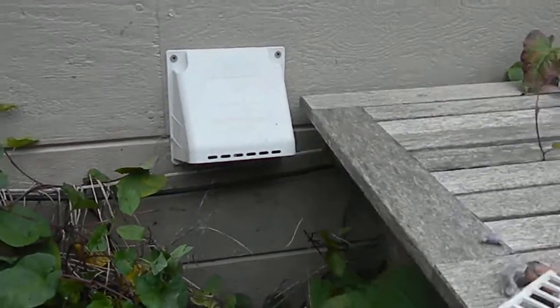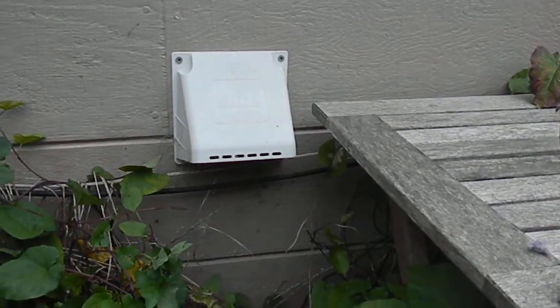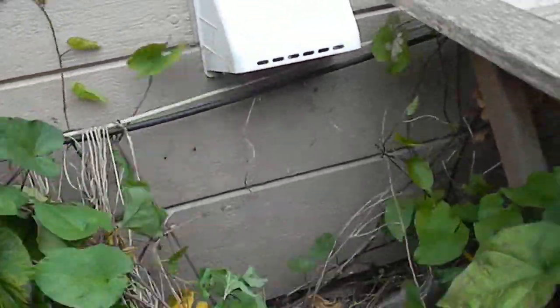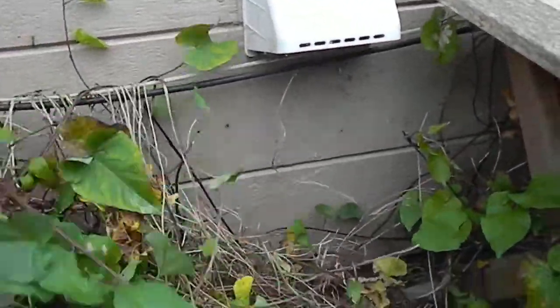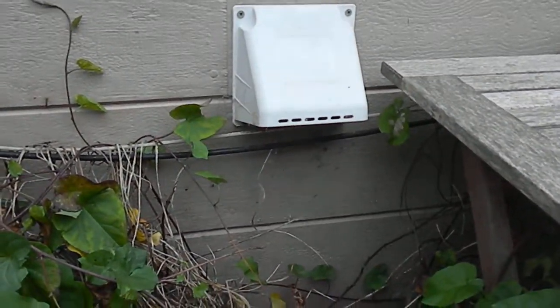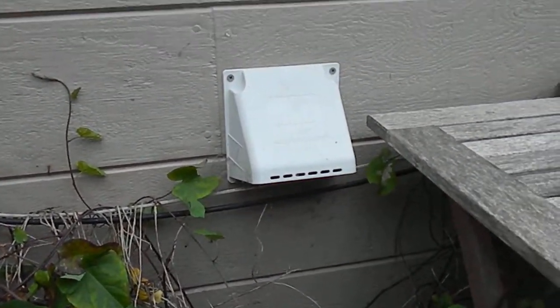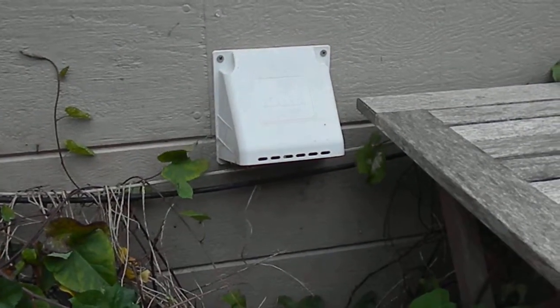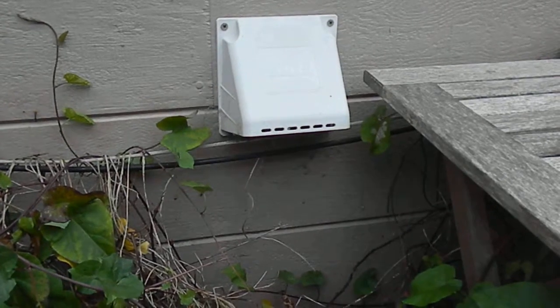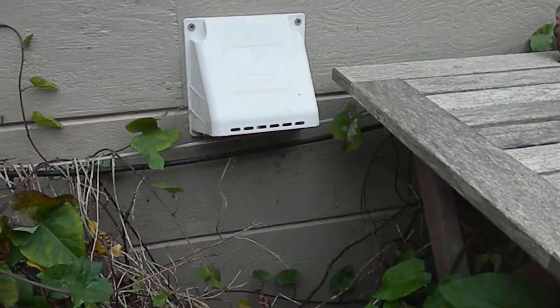I don't like to see these things, or anything else, near the vent, just because it'll blow that thermal cutoff fuse in the dryer. And it's kind of a hassle if you can't dry your clothes when you need to.